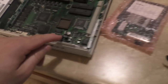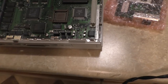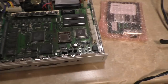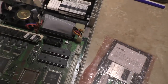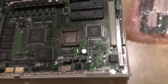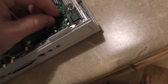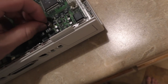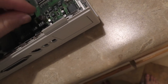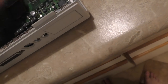Remember, this cap is mounted not to its original pads, but to the adjacent, there is a name for those. I don't want to say rivets, but they're posts, or conducting posts that go straight through the board, and they are secure, but they were never designed to support any components. You rip a post out on a multi-layer board and you're screwed. But these are only 2-layer boards. There's nothing in the middle as far as I know.